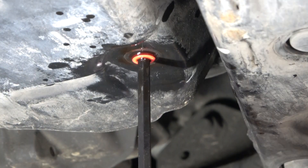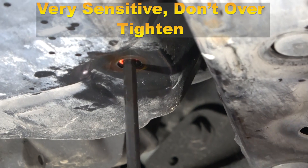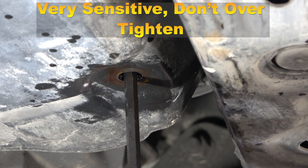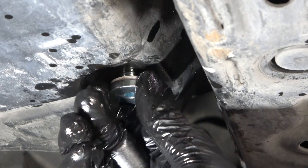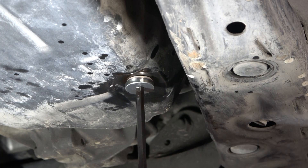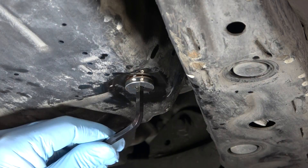When the fluid is finished draining, reinstall the overflow tube. Be extra careful not to over-tighten it — just snug it up a tiny bit. Then reinstall the drain plug using a new crush washer, but only tighten the drain plug a little past finger tight so you don't crush the new sealing washer.